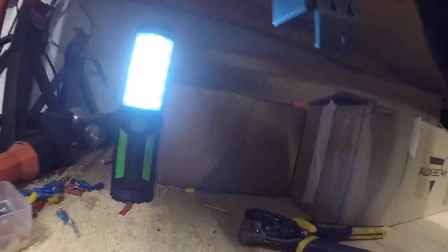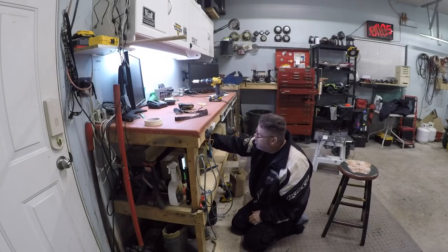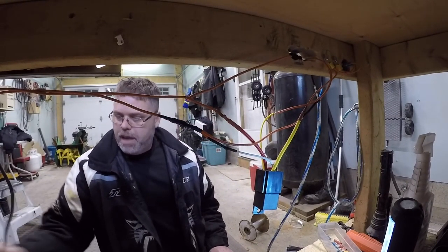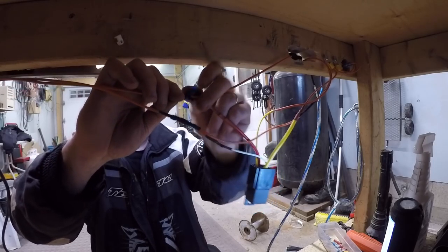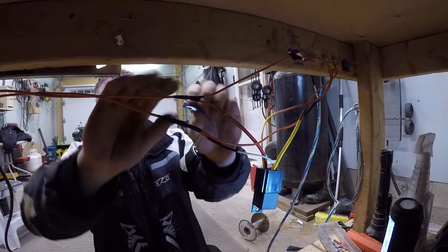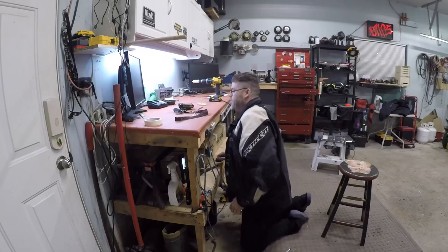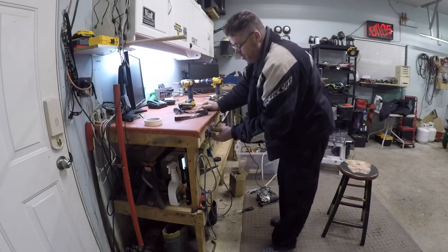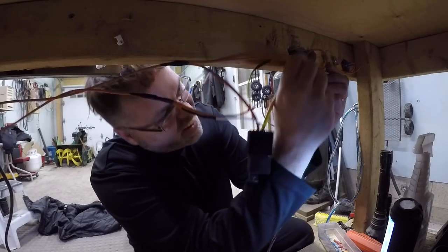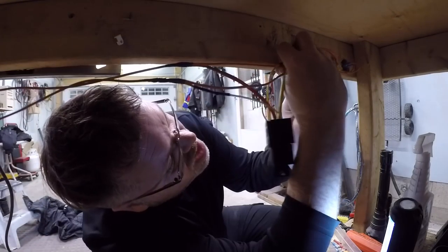And all I need is a normal house light switch actually. If you touch that on there and put that on there — when you flick her she comes on, when you flick her she goes off. There it is — flick on, flick off. And listen to the relay, can you hear it? We'll clean this all up now, make it look pretty and then we'll be good to go. Kind of just monkey rigging this thing together, but like I said she needs a relay because 300 watts weren't liking that little switch. Can't have a test bench that won't handle 300 watts.